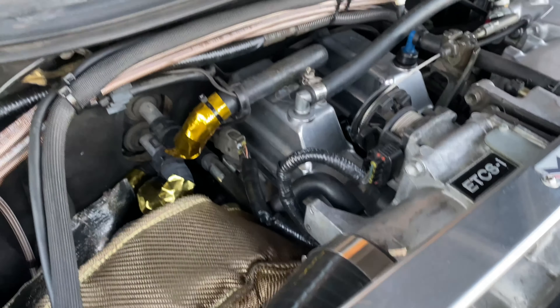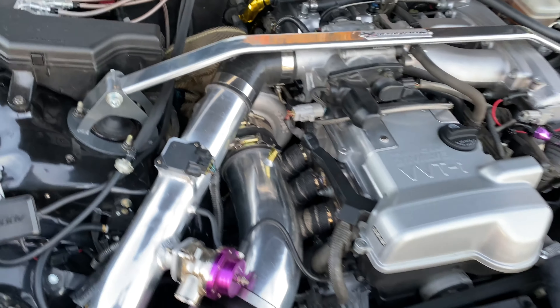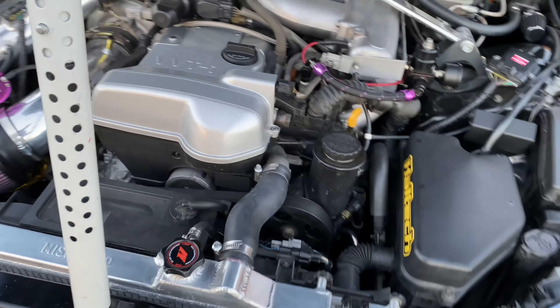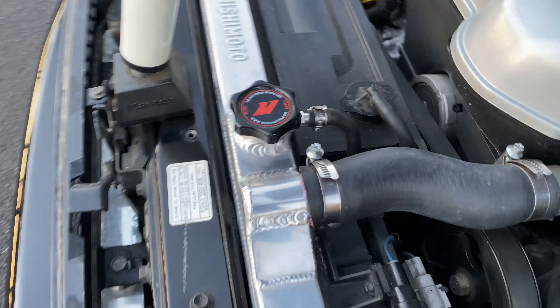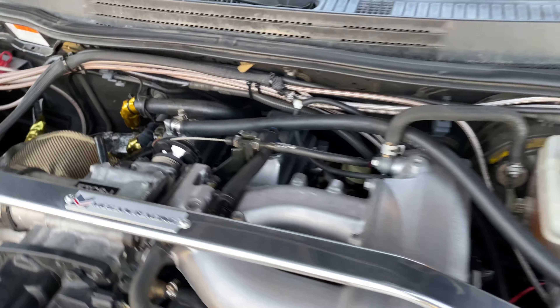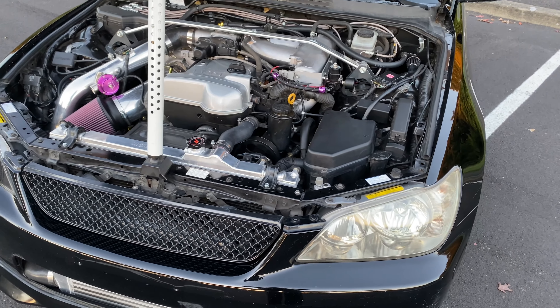I did polish the factory valve covers — they didn't turn out super great but they've got a nice little shine. It is freaking tight in there. I do need to modify the down pipe a little bit more — it rattles a bit on cold starts, you live and learn. Painted the timing cover silver, just personal preference — it was black before. The Mishimoto radiator: I will say I've seen a bunch of people note this, the cap leaks and the hoses leak, so I'll probably end up changing that out. Also did a catch can — you can see it routed to the valve cover — a vented one, not recirculating, because I didn't want moisture and water mixing with oil back in the motor.